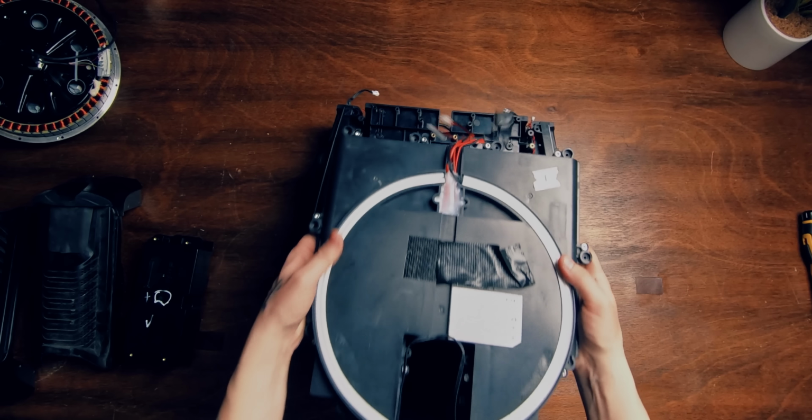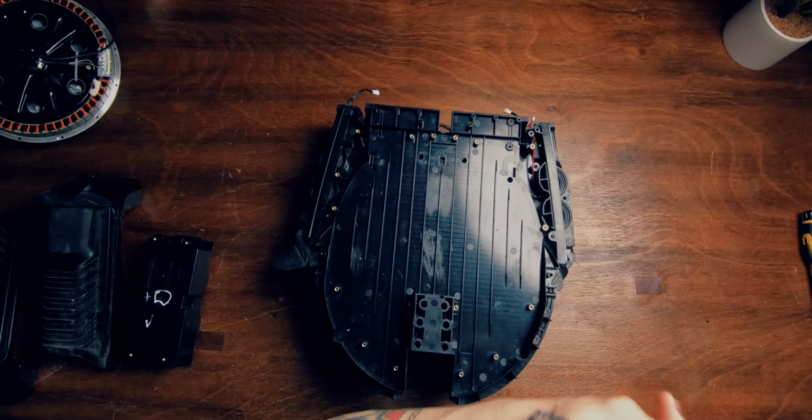And the other part is all those cables have a lot of slack because it needs slack to come in and out and snake around to get on top and connect again. I don't know if it's an issue, but they've given so much slack that when it's connected, you gotta just tuck it down into the creases and crevices, which feels not as sexy as you'd expect from an Inmotion wheel, but everything else is basically cable managed. Just the design of this whole motor block is fascinating. So it's sealed. So you're not gonna have moisture get to your control board like some of the other companies are having issues with, because it's just like an open window right into everything. So this is the battery. Unlike a Gotway wheel or some other company that just shrink wraps it, they have made a watertight seal on this battery enclosure here.